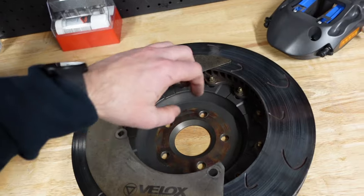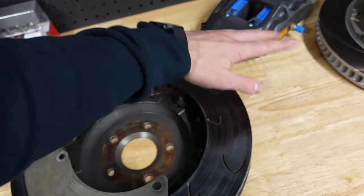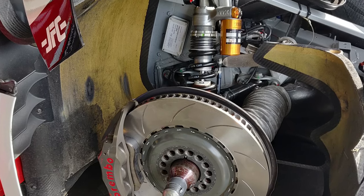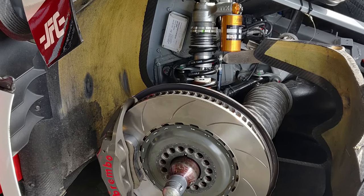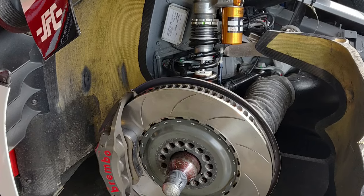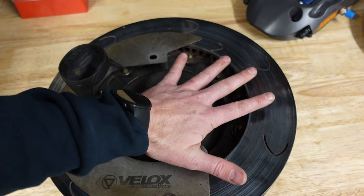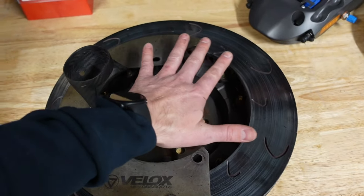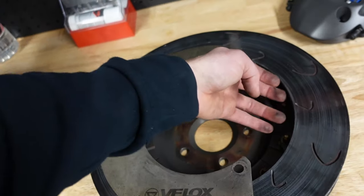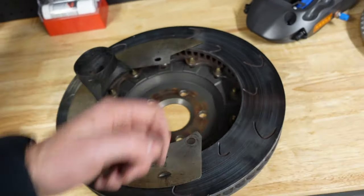Once the air is in, we want it to be forced into these vanes and to help it pump out through the disc. The layout of the suspension, where your brake caliper sits, and how the upright package is with the rest of this duct will determine the exact shape of this. But essentially we want as much as practical for this whole surface to be relatively sealed so when we send air in here, it's forced to go out where we want it — out through these vanes.